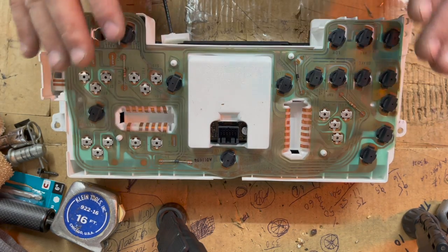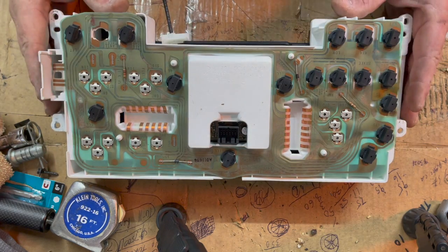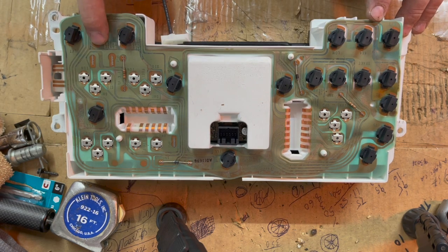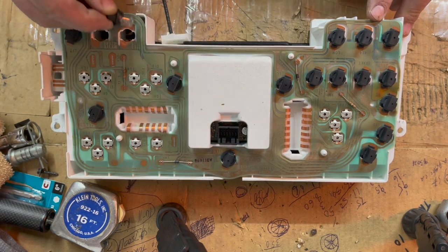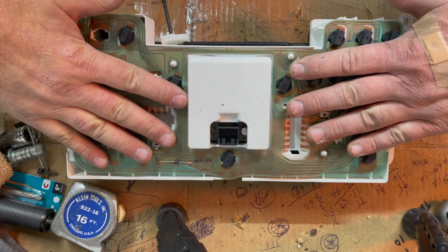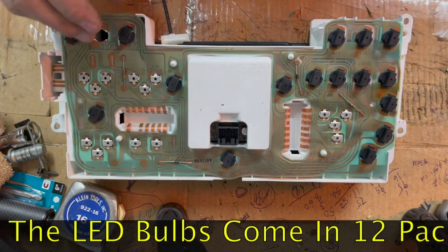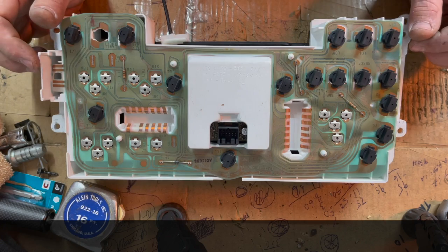I've got the cluster on my workbench. You may want to take some rubbing alcohol on a lint-free rag or some Q-tips and gently clean the contact surfaces. When putting LED bulbs in the bottom warning lights, I would leave the anti-theft bulb out and leave a bulb in the airbag area. On all my trucks I swap out the 11 bulbs up top with LEDs. I get my LEDs on Amazon — I'll put a link in the description. Ten come in a pack but you need 11, so you need two packages.